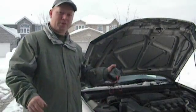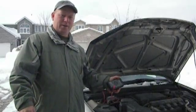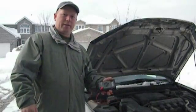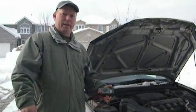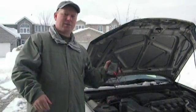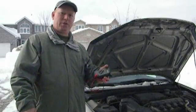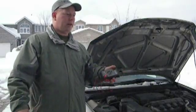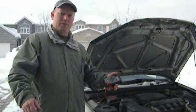Here are the symptoms. If your alternator is going, your car's going to be harder to start, and then you're going to be driving along and it's just going to die on you. You'll try to start it again and it won't start at all — that's an alternator. So if you're concerned you're going on a long trip, or you just don't think your battery's working properly, you can test your alternator this way.